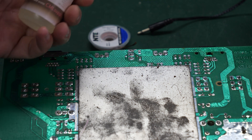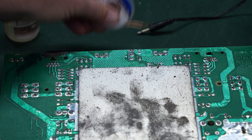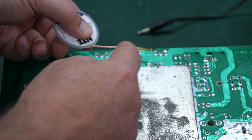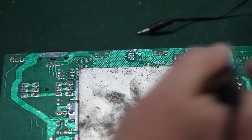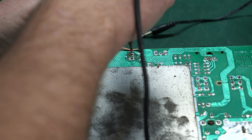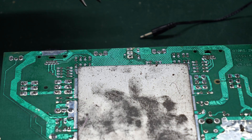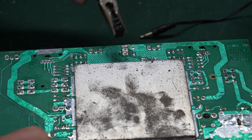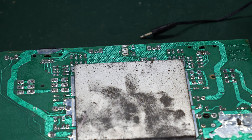In order to get this jack out, you're going to need a soldering iron, and it helps to have a little flux if you have that available. You'll also need some solder braid — the solder braid will help get rid of the existing solder and loosen up those connections so you can get the old jack out and put the new one in. Even if your solder braid has flux built in, I found it's helpful to apply some liquid flux anyway, because the flux in the solder braid can dry out under the high heat you'll be applying. Once you've got the flux down and your solder braid in place, just apply your soldering iron to the joint and the solder should get sucked up into the wick. Once you can see all the solder is removed, you can try wiggling with needle nose pliers. If the part moves easily, all joints are free.